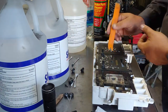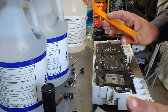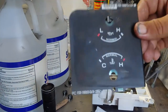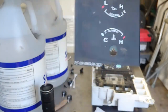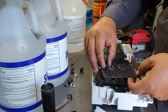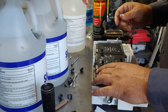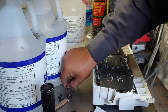To get the needles off, work behind the needle and massage it up to pop it out — it's not bad. People have mentioned a spoon trick but I've never tried it. You can use a pencil if needed. I put marks on the cluster showing which way each needle was pointing for reference when reassembling. Some of these come unglued — you can see the glue points all around. They use a soft glue; this one was loose, this one was okay, this one stayed pretty good.